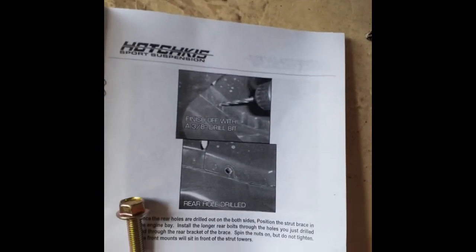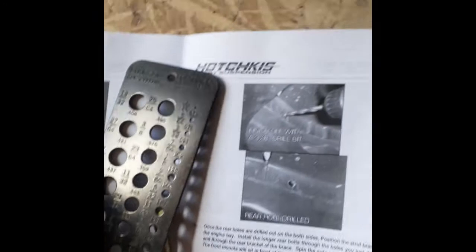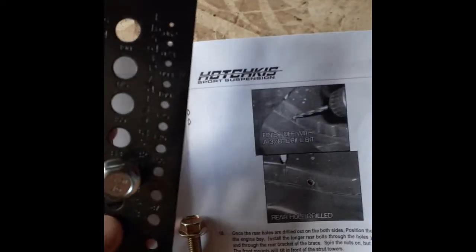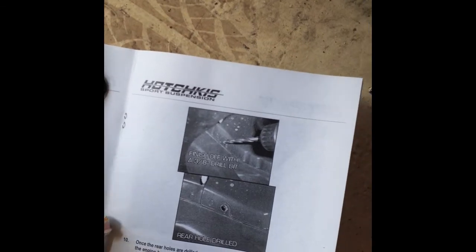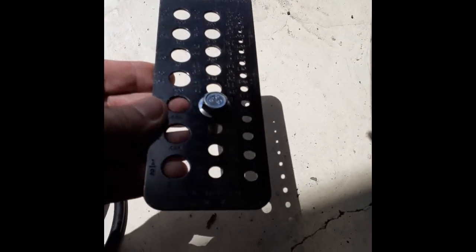So, according to the manufacturer specs, which we've already circumvented for the driver's side, it's a 3/8 inch. However, according to our little friend here, no, it's not. Put it this way so you can kind of see it. This guy is actually right here. I don't know how well you can see it. Ah, son of a bitch. It kind of came out. Sucks doing this one-handed, huh? Okay. I don't know how well you can actually see it. I'll try to get it to the light a little bit. If you can kind of see it a little bit. There you go. It's actually 5/16.